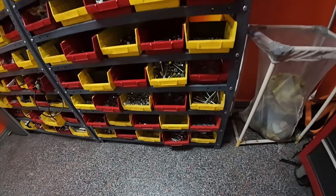I put the balancer in the oven at about 300 degrees for half an hour, had the motor sitting right here, and I was just dreading it — sure it wasn't going to work because I'd had my ass kicked so bad by this balancer. But it worked. Brought it out, it was hot, got it on there, used my little homemade tool, and got that balancer on. What a great day that was. I knew it was going to be all downhill from there.